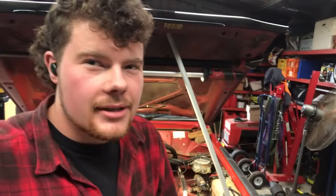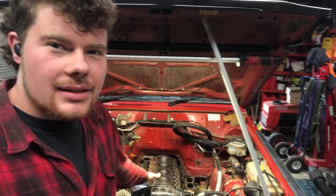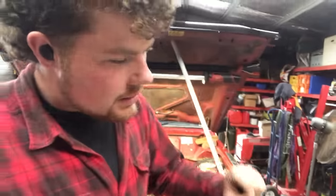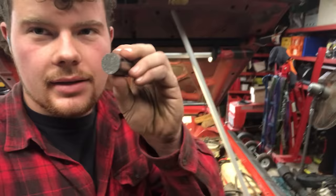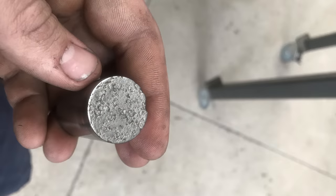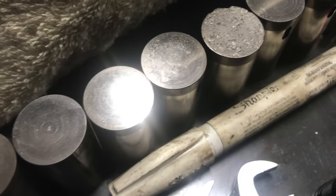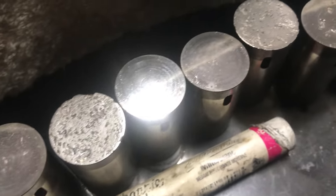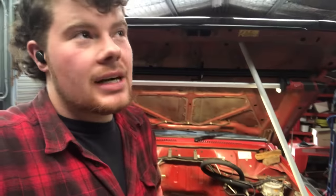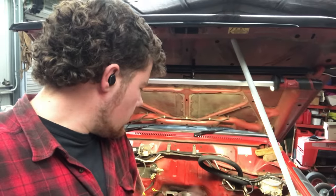To say that this has escalated quickly, I just don't think would really sum it up exactly. After getting the deck ready to put the head back on, I thought I'd just quickly check the lifters — which was a mistake. That is not how that's meant to look. Which is fine if it was just lifters, but the worst part is that being in the state it is, it's also chewed the nose off a couple of cam lobes — which means the cam's got to come out. Which means I either pull the radiator, condenser, grill, bull bar and bring the cam out the front of the motor and hope the cam bearings aren't worn, or I pull the whole motor out.